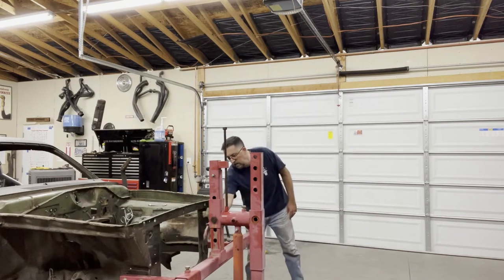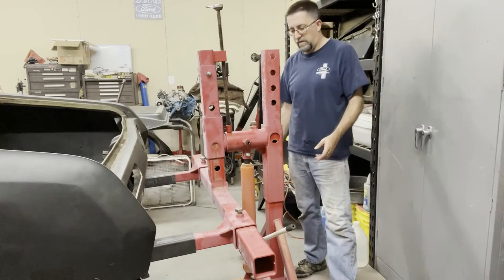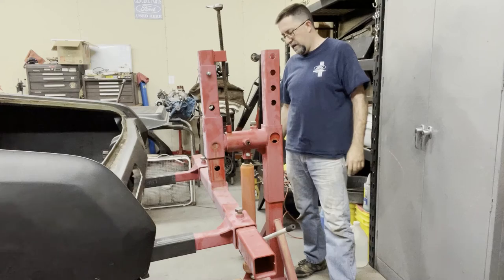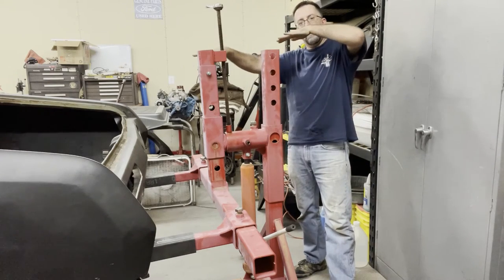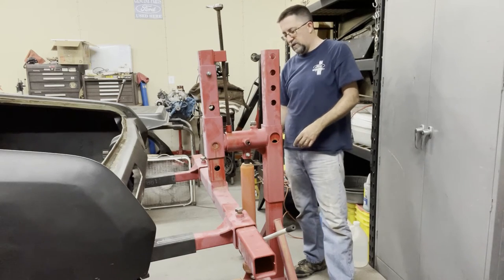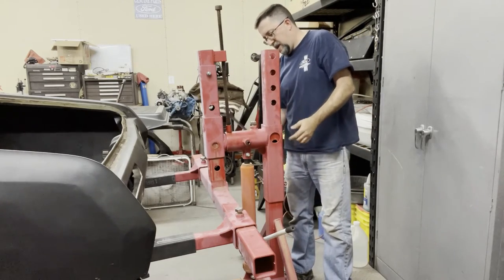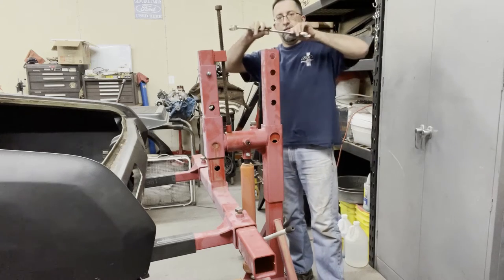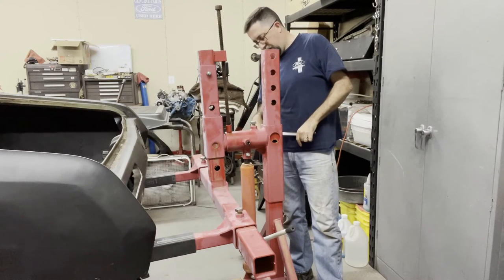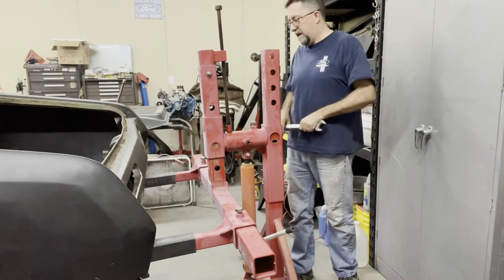So this is on the third hole, and you can get this one on that third hole as well. Okay, so we've got an issue — the weight is on the rotisserie and everything is leaning this way, causing it to bind, and it doesn't want to go down. I release the pressure on the jack, and this is holding loose so it should be dropping, but everything's binding. All the weight is out here, binding everything up. I've got to figure out how to release it from binding without it slamming down on these jacks.